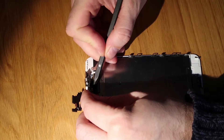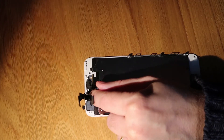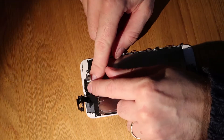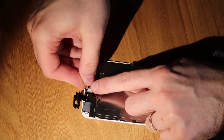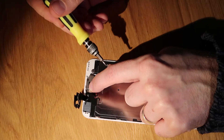If you're ever having trouble where you hold your phone up to your head to make a call and the screen doesn't go dark, that's the proximity sensor damaged — so you'll need to replace this part. To reassemble, just pop the speaker back in place, then pop the camera back down over it. It will fit in place over the top of the speaker, then the metal bracket goes on top of that, and the three screws go back in to hold it in place.